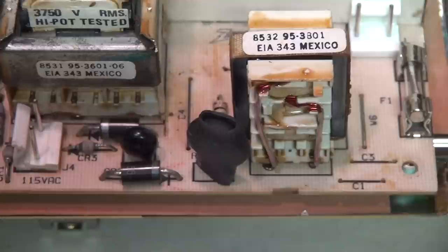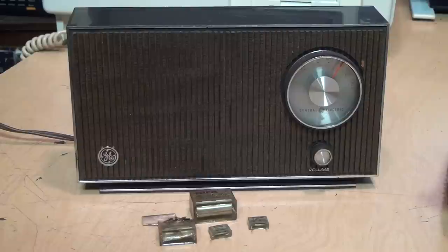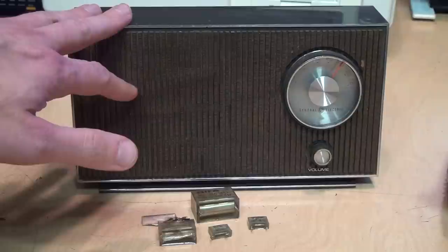The power supply and thus the computer will still work fine with all these capacitors removed — it'll just be more prone to electrical noise coming in on the AC line. So if someone turns on the toaster and your computer crashes, you'll know why. Also, without these capacitors installed, the computer itself will put out more electrical interference — not good for anybody listening to AM radio nearby.